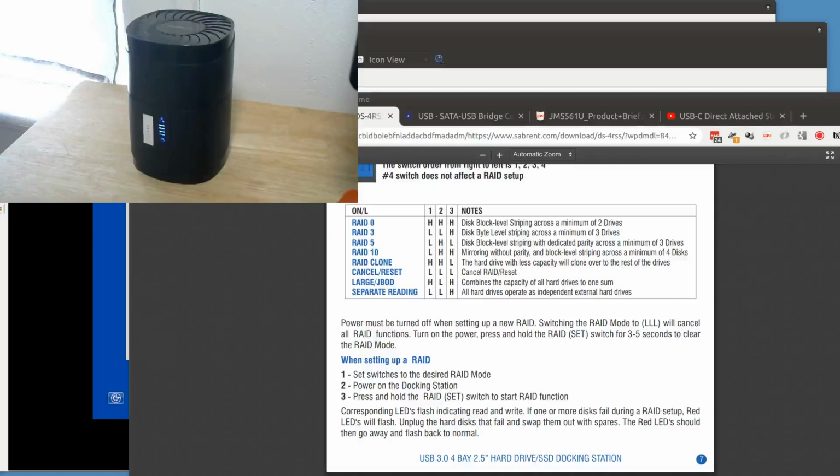If the drive goes out of sync, the array goes out of sync and one of the drives needs to rebuild. While it's rebuilding, you turn it off, remove that disk, turn it on, put another disk in, and turn it on until it starts rebuilding to the new disk. Then you turn it off again and put the old disk back in. So kind of what you're trying to do is, you mistakenly put a new disk in, but now you realize, I should just put the old disk back in. It starts over at 0%. Yeah, it'll start over. So I think that's just an extended case of what happens if you shut it off, yank a drive, turn it back on, turn it off, put the same drive back in. It's the same thing. So it starts over at 0%.